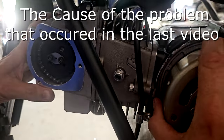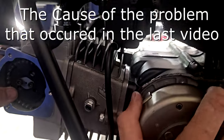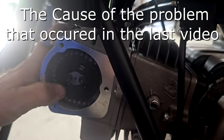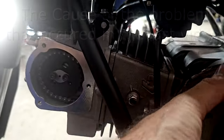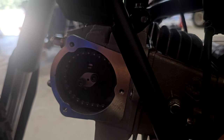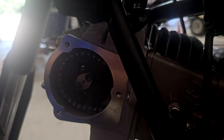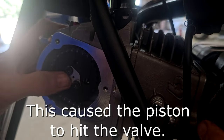All right, so if you're turning it backwards, which I know that's not what it does, it acts like it slips in here. But if you turn it forward, it acts like it has all the chain on the gear here. And the only problem we have is this. As soon as it hits that stroke, it then jumps. Then it jumps time around.